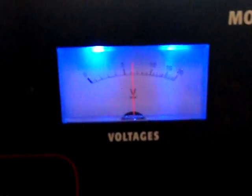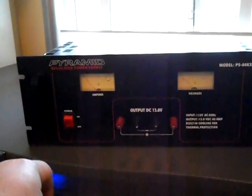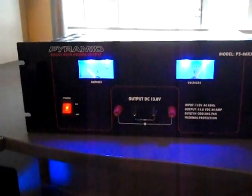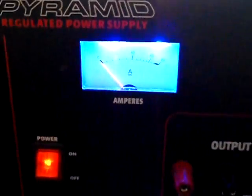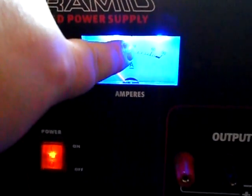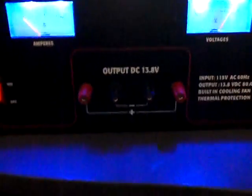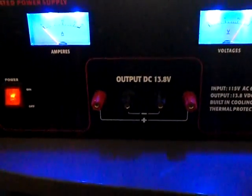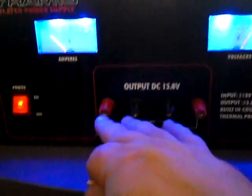After turning it off, you'll see it start dropping — right there it shows 15 volts. I just put those lights in the other day because normally when you're looking at it from this angle you can't see, but the lights help out a lot. They do look overly bright but that's just the camera — they actually look good. That meter shows amps: zero is straight up, 40 is to one side, then 60, then 90. This thing should pop right at 90 amps, but it's been modified a bit so it's probably closer to 90 to 100 amps.